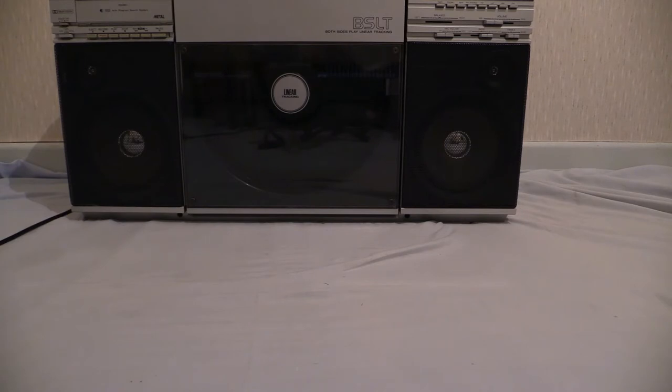I might also like to point out: with these boomboxes, if you're playing the record and you turn the volume up a bit too much, sometimes you get a bit of feedback. The vibration from the speakers makes the needle vibrate, which goes to the amplifier, which goes to the speakers, which feeds back to the needle, which goes to the amplifier, then to the speakers — and it just gets worse and worse. You get all sorts of rumbling. If you don't quickly turn the volume down, it'll either wreck the vinyl or damage the boombox — for example, blow one of the speakers out. So be mindful of volume levels when playing records.